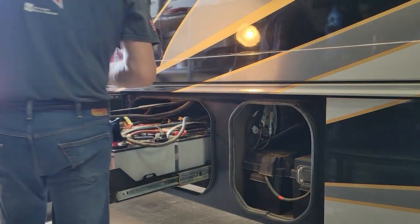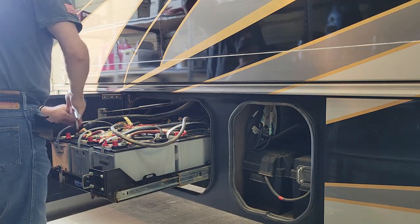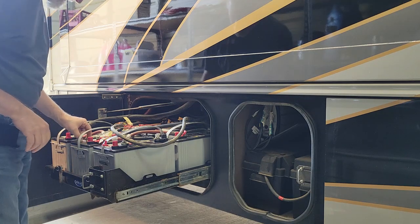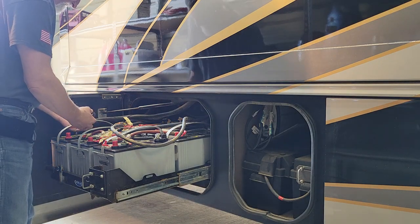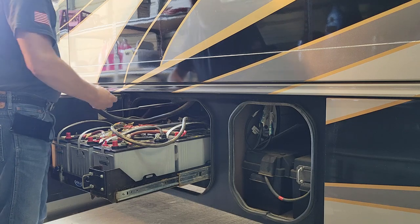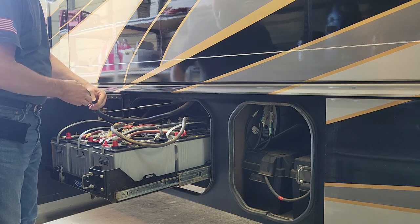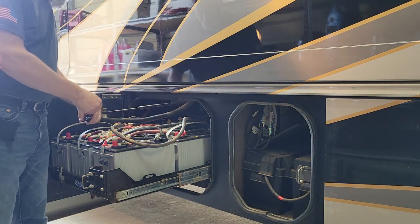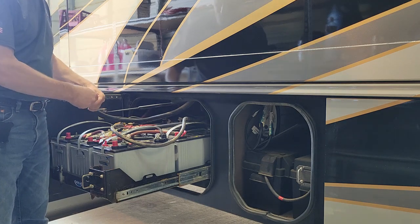Okay. Let's start disconnecting. Do not like disconnecting batteries, but it needs to be done. This is just safety precaution. Just throwing a bunch of electrical tape on the positive. Trick I learned a long time ago, when wrapping up with electrical tape, when you're all done, fold the last half inch over so you know where to start when you go to start untaping.